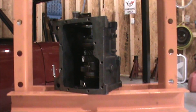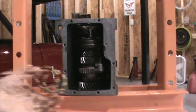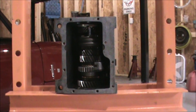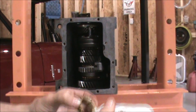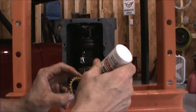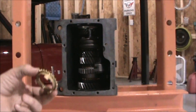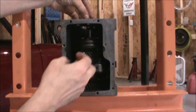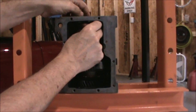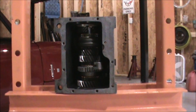We've got the wire off. Now what we'll end up doing is putting on the last of the balk rings. Of course, put a little bit of lube on the balk ring so that it doesn't run dry, and we install that through the top of the shaft and insert there. That balk ring is now in.